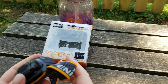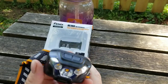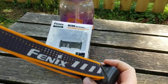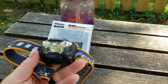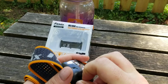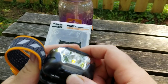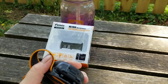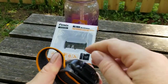The light is IP66 rated for water and dust intrusion, meaning it'll take a pretty good beating in the rain and should be fine. I wouldn't submerge this light though — it's not IP68. It uses micro-USB charging; they have not put the new Type-C in here, though the micro-USB is a lot smaller. The charging port cover fits in nice and snug, and even doing a yank test it will not come out — which is always a good thing.